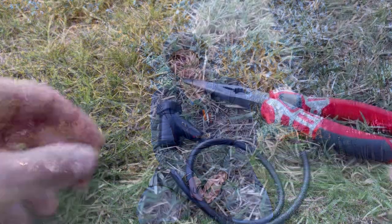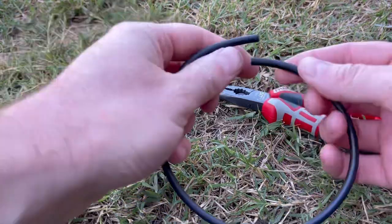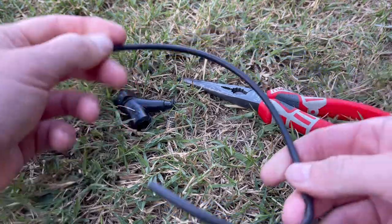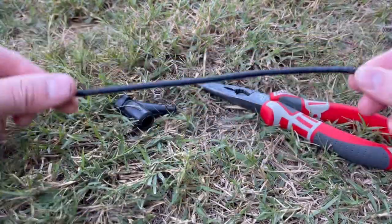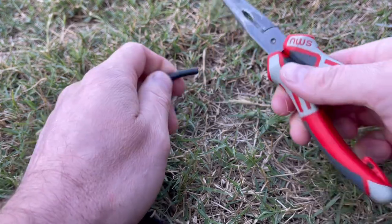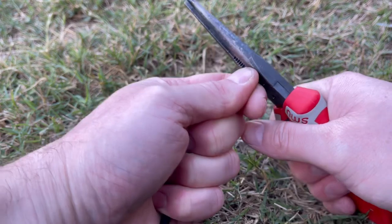It's a lovely day so we're going to stay out in the park and do it. He had actually cut his coil wire too short. Fortunately for him, his coil can have the wire replaced separately — not all can, especially the more modern ones. I picked up this wire today from the Stihl shop. The first thing I want to do is remove about a centimetre's worth of insulation, which is going to allow me a better connection when the barb is actually seated in place.